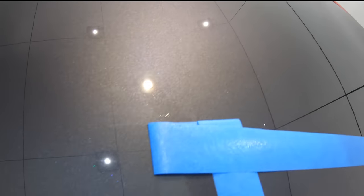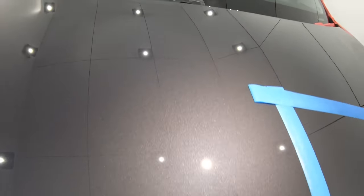the paint. I've actually had some fantastic results using Shine Supply polishes and compounds in the recent past. But to be honest, I've still yet to have any success with Classic Finish, that really seems more like a specialty polish that needs that specific type of paint, pad, and technique to achieve success. So in this case, both the cutting and finishing qualities of this combination just weren't great on this paint type.